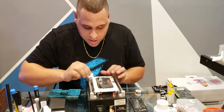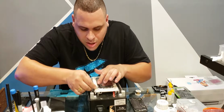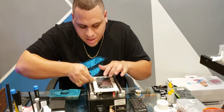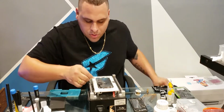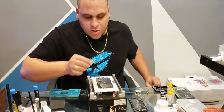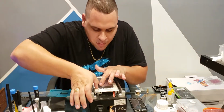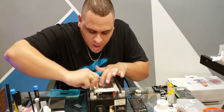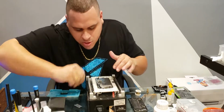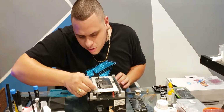If you don't get rid of this glue, your wire will cut in between this glue, and it will cause you to cut into the screen, because that wire's got to stay in that same spot. A little mountain of glue can change that. Now this is the iPhone, so you can use thicker wire. On Galaxies, you want to use 0.5 or 0.4, but on iPhones, that's not curved. There's no iPhones curved, but on screens that aren't curved like this, with LCDs, you can use thicker wire.